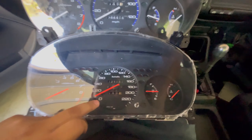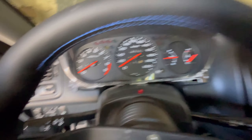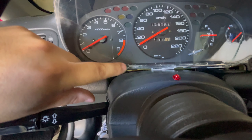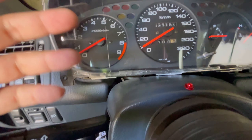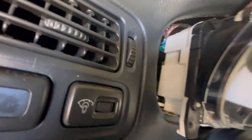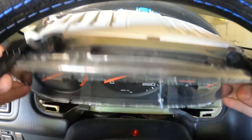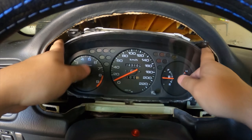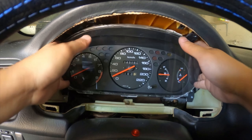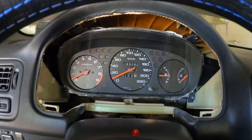Let's install this thing and see if we do have the amber light-up so we can change the amber light-up on the climate control too. One difference I noticed on this cluster is we don't have the cruise control light, which is fine because I removed cruise control from this vehicle anyway. That green plug in the back won't be plugged in, and the yellow plug is for the SRS but since we already removed the airbags there's no point plugging that one. Let me go plug the battery in and then we'll jump back into this.